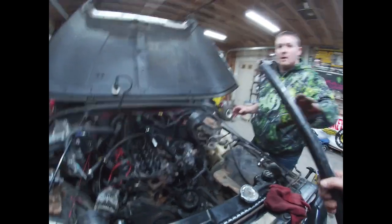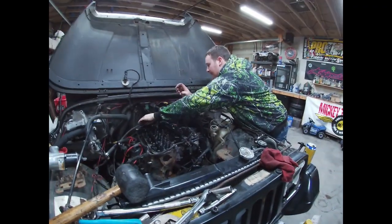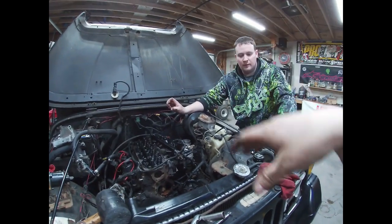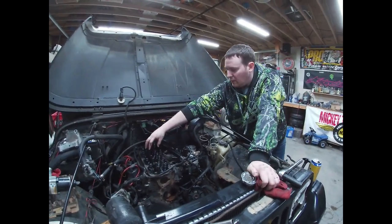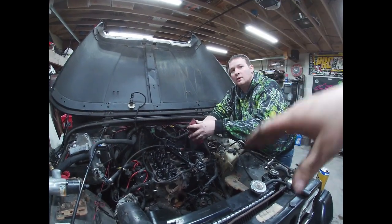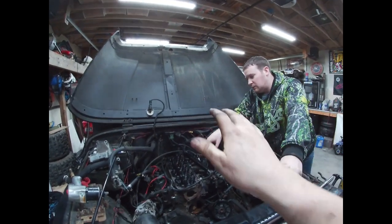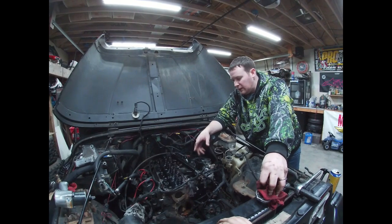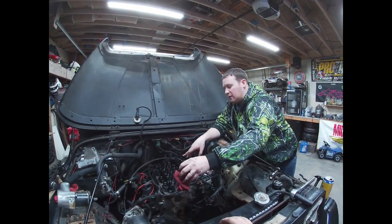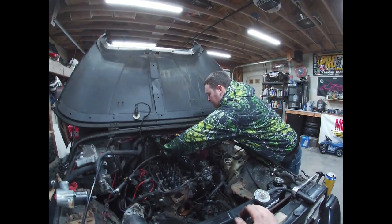Now, technically, is that maybe another part of it? Like if you take the head bolts out evenly, it'll cause less pressure on one bolt? Yeah, you want to always start from the middle and work your way out, because then you even out the pressure on the bolts too. Since that was the last one, everything might have been pressured on that one, just maybe the pitch. Yeah, I mean, it doesn't matter, as long as we started from the middle and worked our way out, which we did.